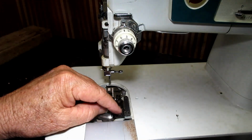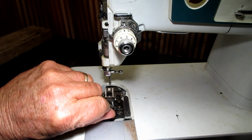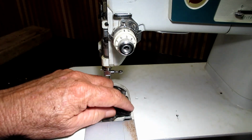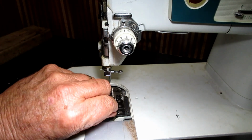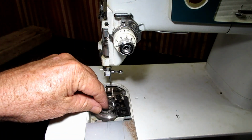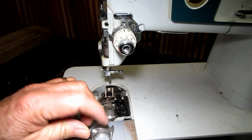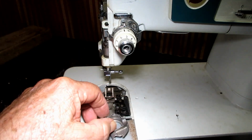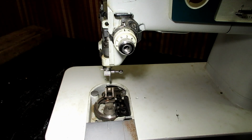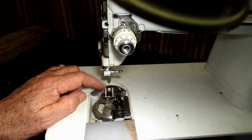See that bigger screw in the front right there? We're going to lift that up off that screw and just swing it to the right, and you'll see it doesn't lift very much and it doesn't slide over very much. Just a little, just enough to lift it up off the screw and then slide it over, and that's going to allow me to twist the bobbin case off of the little shelf, the race of the hook. There's my non-working hook, and I'll take out this Class 66 bobbin case. Alright, then I'm just going to push this positioning bracket over and back on the screw.